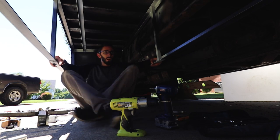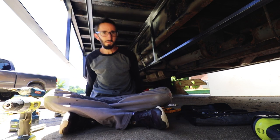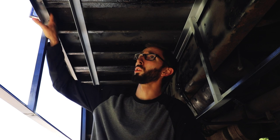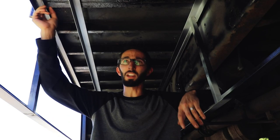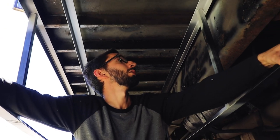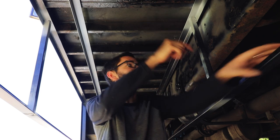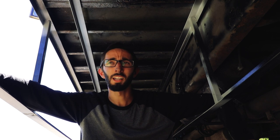So it's like a new day because of this brace setup. The reason being is this bar is too far over. On the inside we've got that bus wall — it's an inch and a half thick — and this bar is also an inch and a half thick. So if I were to screw in the center of it, I'd be screwing into the center of that wall and I can't get a bolt over there. So I had to put in this brace to zip it up on this side. I'm tired — it's been hot. This one is pretty much in. I've only got four bolts in currently and four is probably fine according to the load ratings. I'm going to do four on the back, four on the front, into the actual frame of the bus — just cause, why not? And then that should be enough.